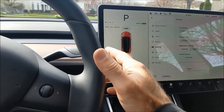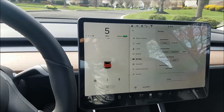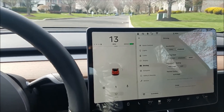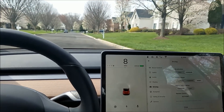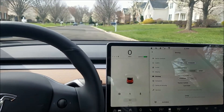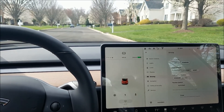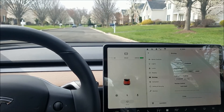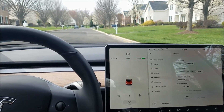Let's turn off creep — I have to put it in park to do that. I'll get going on a flat road, put my foot on the brake, get to zero, and let go. So in creep mode you have to press the brake pedal a little extra hard once you get to zero for it to go into hold.